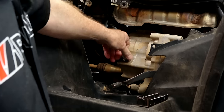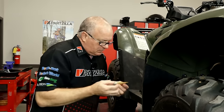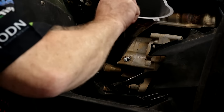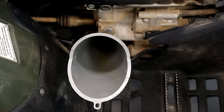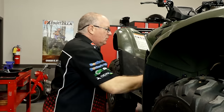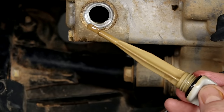Let's see where we ended up. When you're doing this, you do not screw the dipstick back in — you just plunge it and then take the reading. She is right at the bottom, so Honda was pretty much dead on about it needing three quarts. Adding a little more should bring it up to the appropriate level. Now let's take another reading — we're just bringing the level up, no need to restart. And there you go — right at the bottom of the top of the mark. That is as much as we need in there.